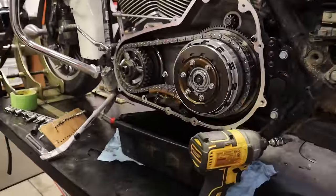We're going to tighten to 13.6 to 19 NM and 120 to 168 inch pounds. There's also a note that if the engine was left in chassis for service, final tighten the rear left rocker housing bolt using a torque wrench with a quarter inch drive.